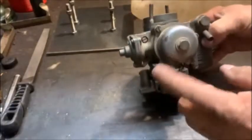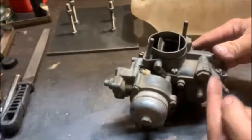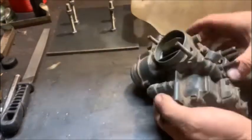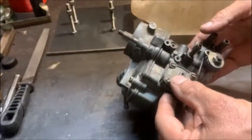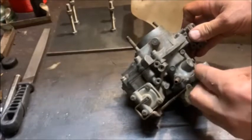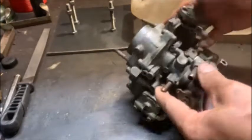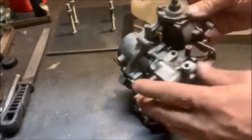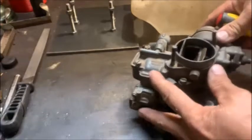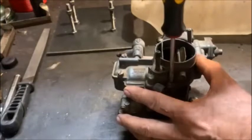So this is the carb. Impressively it's got a water choke on it, it's got a fuel supply and a return, which I didn't expect from an old carb like this. It has an accelerator pump like any other carb, and it's got a little section where you put water through that warms up the carb - obviously for colder countries. There are a couple of things wrong with it but I'm going to take it apart and get it in my cleaning tank to get most of this muck off.